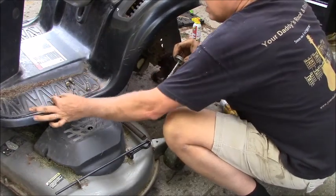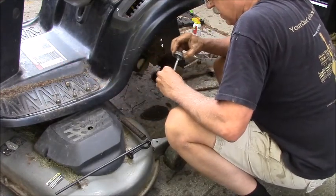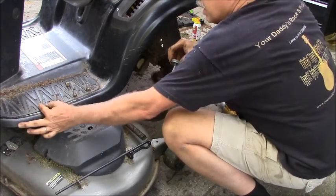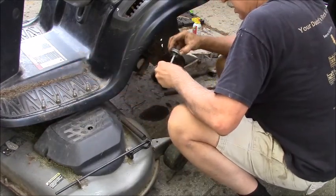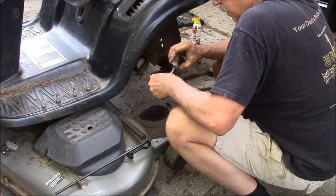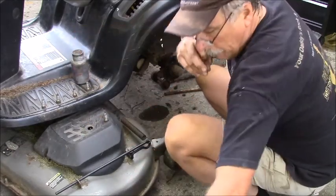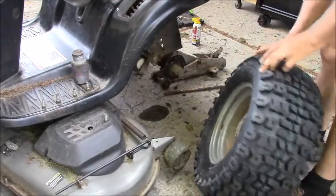In case I ever want to get these lug nuts, lug bolts, these are like a Volkswagen wheels, at least on the old Beetles. I think on the buses. Yeah, I had a bus and it had bolts instead of lug nuts. So that's what we got here. Okay. This will just help them from rusting together and never coming off, snapping off next time I put them on.